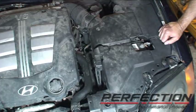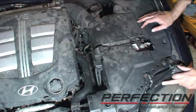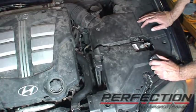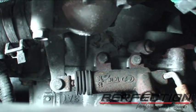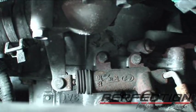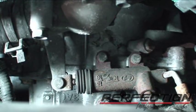This is our starting point and somewhere underneath here there's a transaxle. Let's take a listen and see what one of the driver's complaints was about this vehicle. There's the slave cylinder and the release arm — go ahead and push the clutch pedal. You can hear we're getting some kind of nasty creaking sound out of this, and that's one of the things we're going to cure.